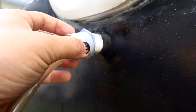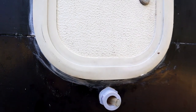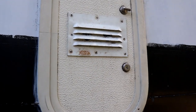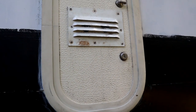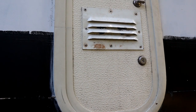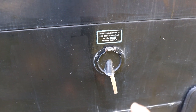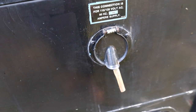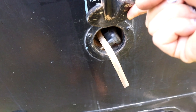There's the curved pipe that this inserts into, then comes out this way. I had to trim the pipe, pulled it out a bit to cut it down, then pushed it back in and put the back fitting and front fitting on. I already have sealant on the inside. Everything is complete — the drain hose is out, that's all sealed up, and I have the vent in there for the refrigerator. The only thing left out here is to replace this lock, since when I bought the $5 door they didn't have the key — but those locks are only a couple dollars. I can finally pull out this old hose, which wasn't working well anyways — it had a kink in it strung through the wall.